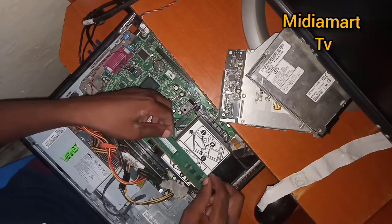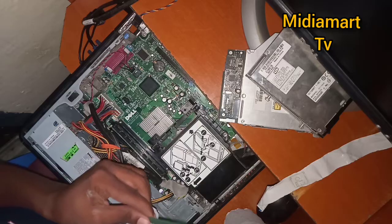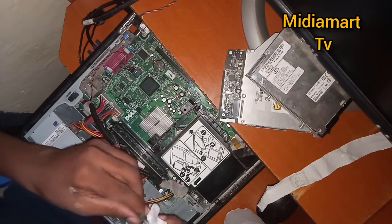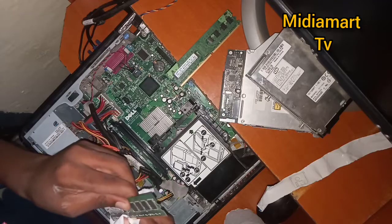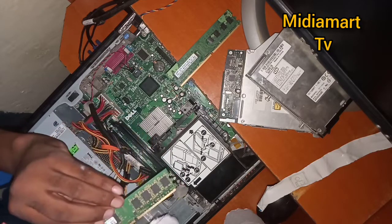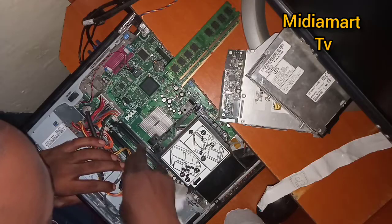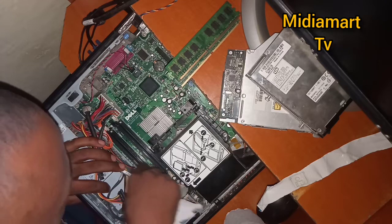The memory has to be cleaned. I'm going to remove it and then you can clean your memory — wipe it out. If it has some problems, this can solve one of the issues. This area here I think is affected by dust, so if you have a blower, you can blow air into these memory slots, because sometimes they are clogged with dust. Blow here perfectly to clean them out.